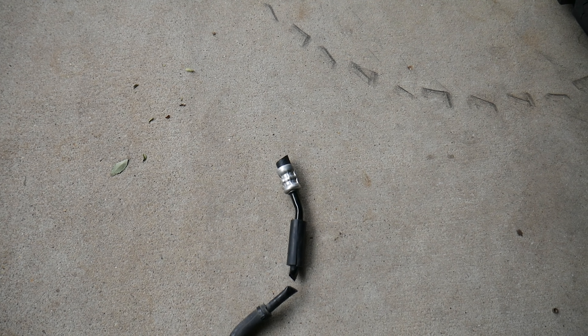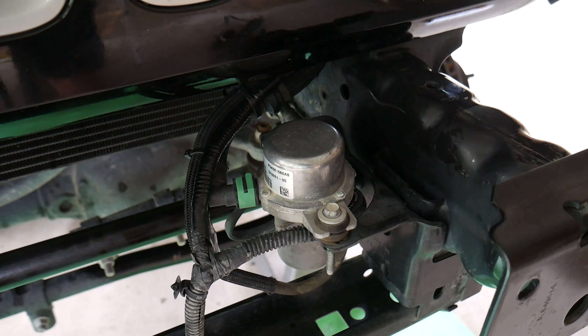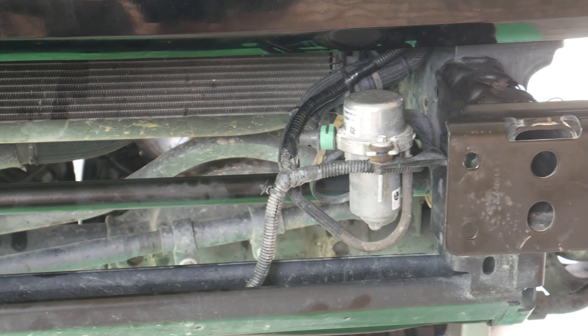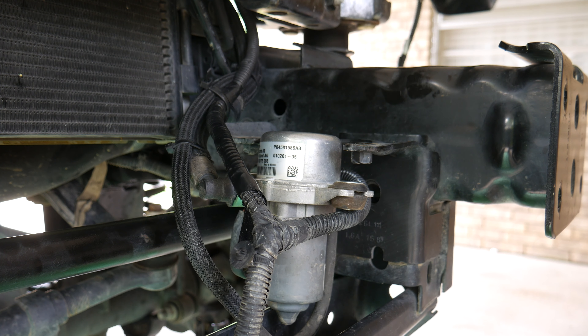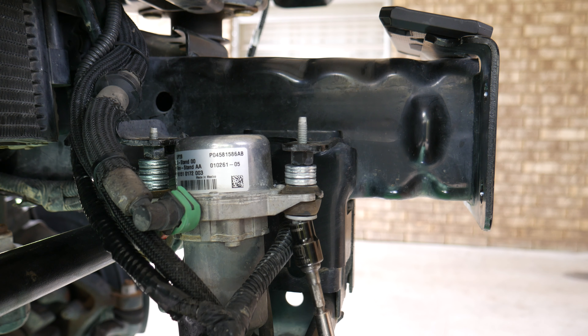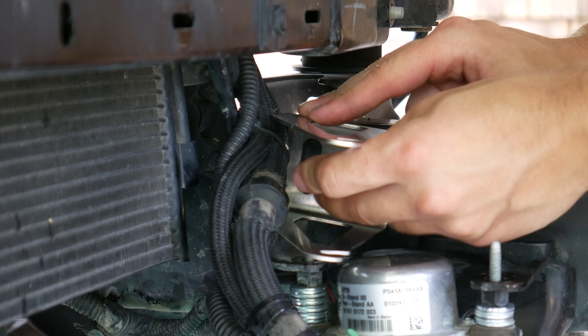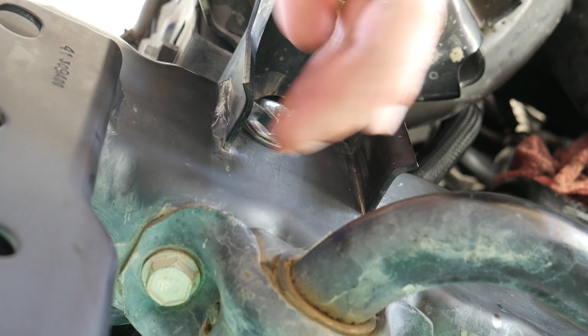Here's a look at all the lines we cut out — that's the part on the driver's side we cut, goes down across where the bumper mounts, and then back up to the part we disconnected from the reservoir. Now we can finally talk about mounting this thing up. On 2012 through 2018 JKs we're going to have this vacuum pump right in the way. For my location the vacuum pump just needs to be a little bit further down, so I remove the bolts, set the vacuum pump on the bottom of the bracket, and reinserted the bolts upside down with some washers as spacers. Finally we can go ahead and mount up the brackets — I'm mounting mine through a pre-existing hole in the frame, hand tightening for now and we'll torque it down once the cooler is in place.